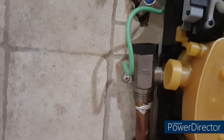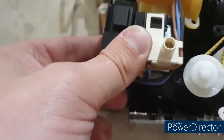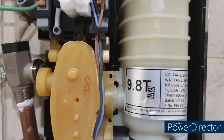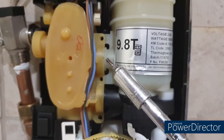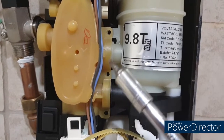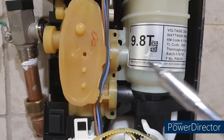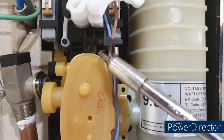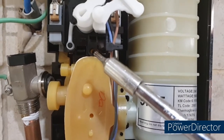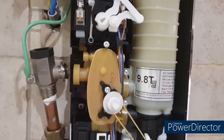You've got the two white pins underneath, the activating arms under the micro switch arms, and the black pin on top — all of those need to align. The next alignment is on the right-hand side of the valve where it makes contact with the two ports on the heating element. I'll do that side first then move to the inlet. Make sure the blue and brown cables are nicely tucked in and clear at the bottom. It was quite a fiddle to get these two to line up, but you can feel the O-rings rolling over the ridge where they need to be.